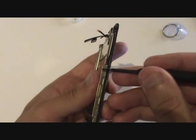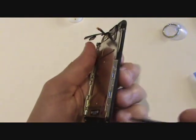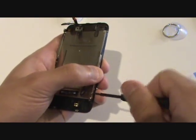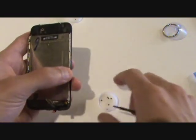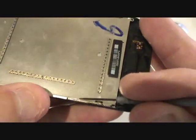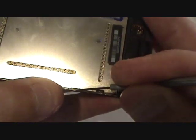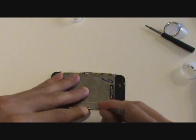Now we are going to be removing a total of six Phillips screws along the sides of the mid-frame, as well as one on the other side. These screws may be covered by tape on your device and you can just remove that tape — it is not necessary to reapply it. For this next step, you are going to want to be really careful so that you don't end up cracking the LCD screen. You are going to want to wedge your flat head screwdriver in between the front glass and digitizer assembly and the LCD frame assembly, and this will allow you to remove the old LCD screen.